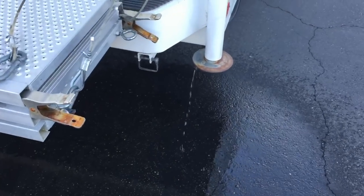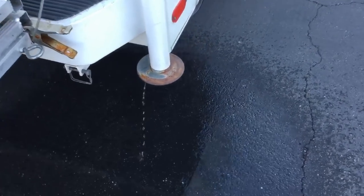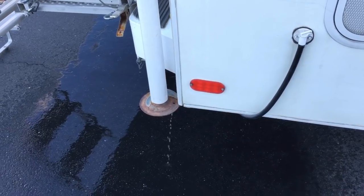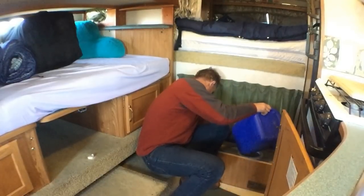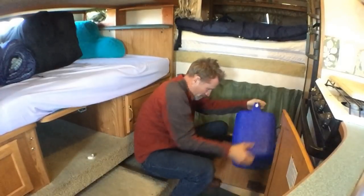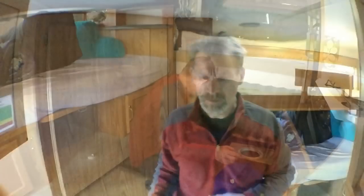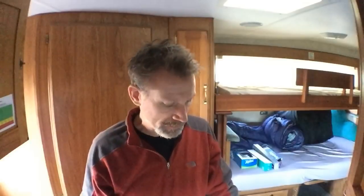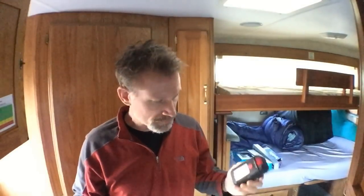That's the first flush of fresh water through the drain hose. I'm going to close this up, put another five gallons in, and pressurize the system to get everything out of the lines to the faucets. Now with five gallons in, I'll turn the pump on and prime the system. I'll check for leaks where I removed the screen filter and anywhere I touched any water lines — everything looks good, hand is dry. A good bright flashlight really helps back there.